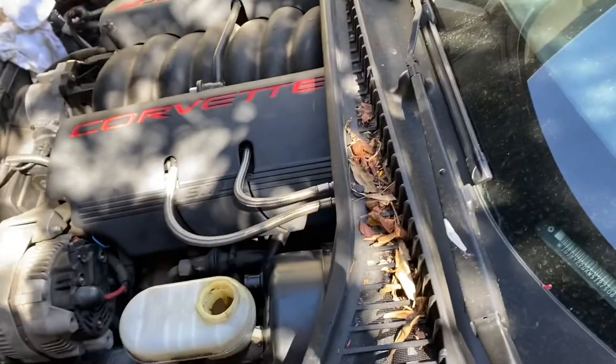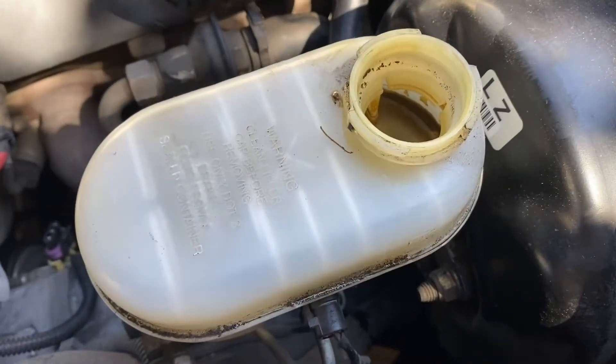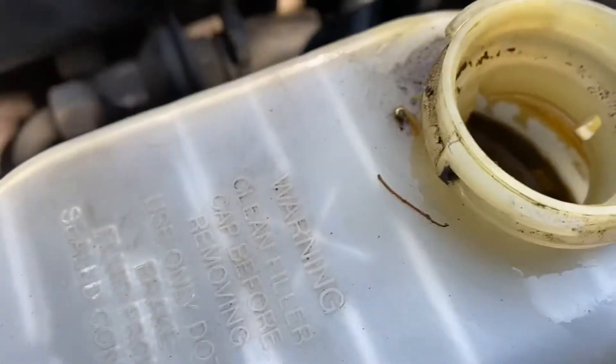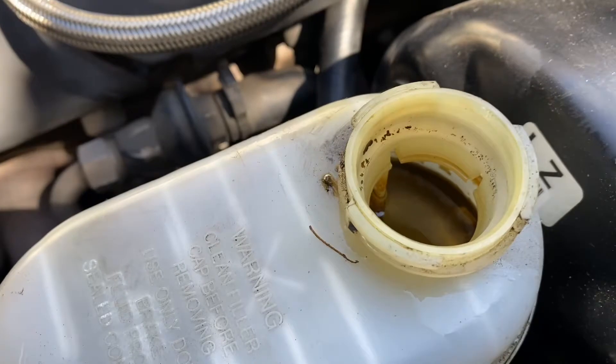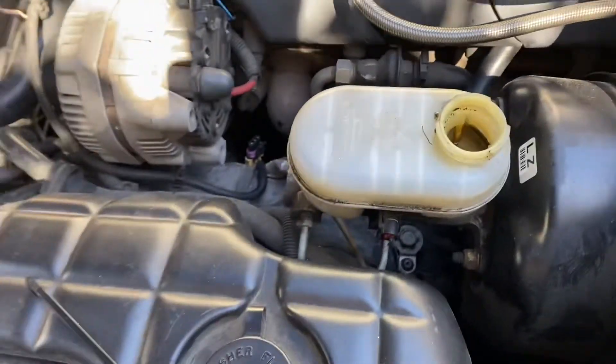While you're pumping the brake, every once in a while come out and check the fluid level in the master cylinder. Make sure it's not getting low — it's getting a bit low right now, so refill it to the top and then keep going. If it gets too low and starts sucking in air, you'll have to redo the whole procedure, so keep an eye on the level.